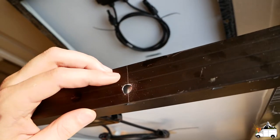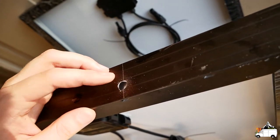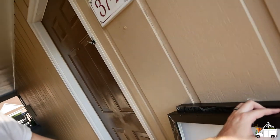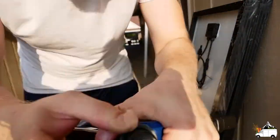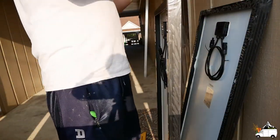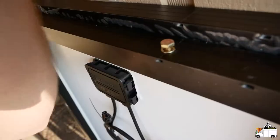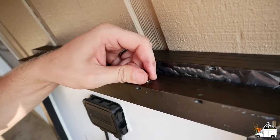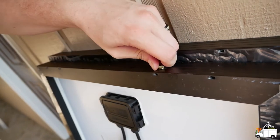There's another piece of metal here, so I'm not sure I'll be able to install the rivnut. I'm going to drill through and test it — try to put one rivnut in. Hopefully we don't have any issues. It seems like it actually worked! As you can see the bolt went in. I'm pulling on it a little bit and it's not moving at all. So I'm going to tighten it down all the way — it's not freely spinning.